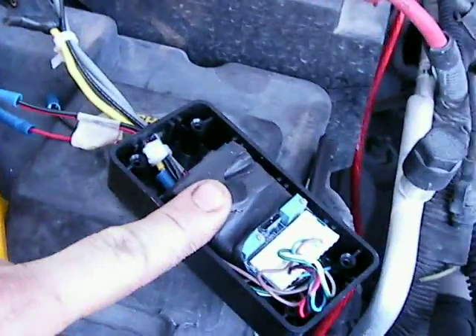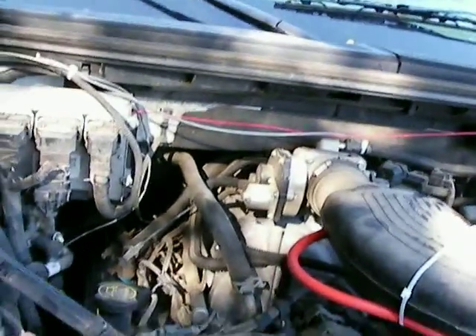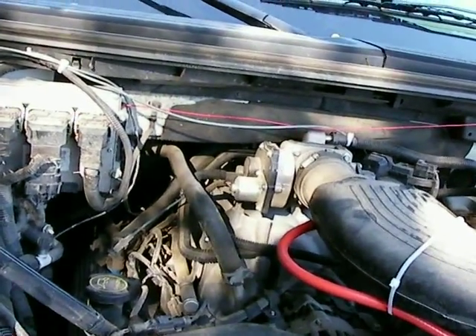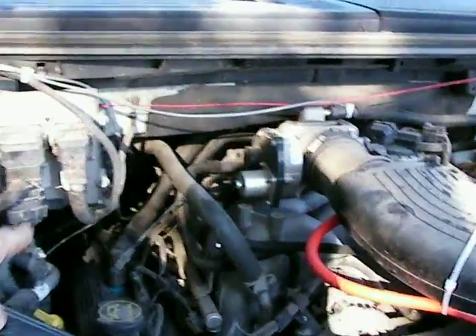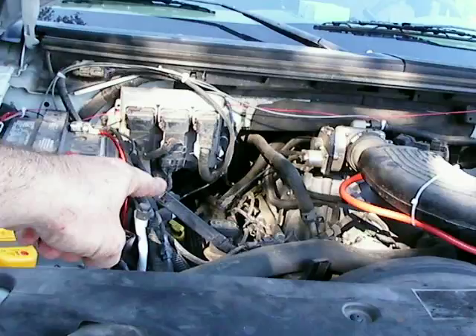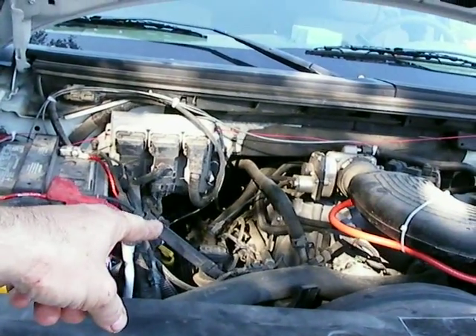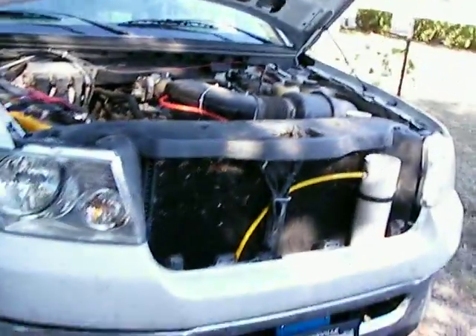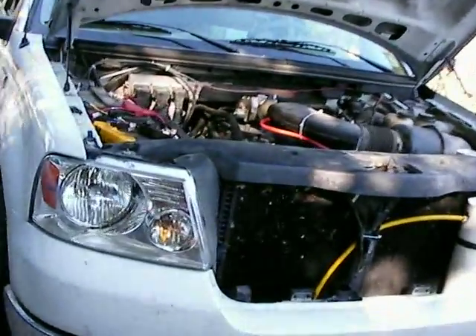Here's my IFE circuit. It hooks onto the two oxygen sensors. There are four oxygen sensors on a Ford F-150 — I think this is a 2006 or 2007. This one has the oxygen sensors in the catalytic converters and two up front. I'll tell you right now, on the passenger side of this truck, that oxygen sensor — you will invent cuss words trying to get to the wires. If you're going to put an IFE on one of these newer Ford F-150s, you're in for a real surprise with that passenger oxygen sensor.